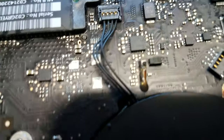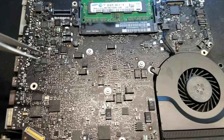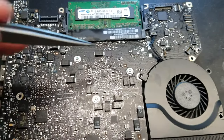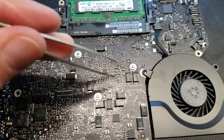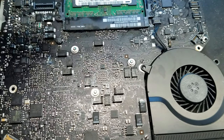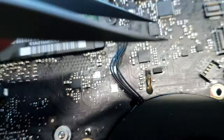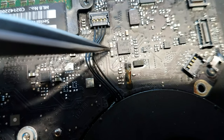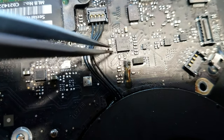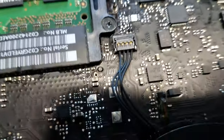I just wanted to make people aware of that. If you have an 820-2936 board from a 2010 or 2011 13-inch MacBook Pro unibody and you see that happening, it could be a power state above the one you're measuring. I was measuring an S5 power rail, and it was oscillating — not zero volts, not shorted there. The fact that it was going 5 volts down to 3, back up to 5, doing that rapidly, means something further down the line was actually shorted.